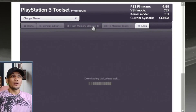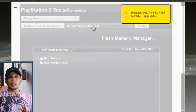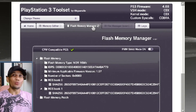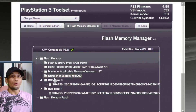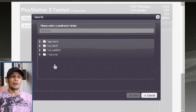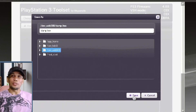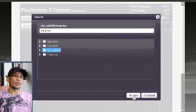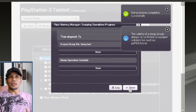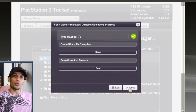If you receive any error message it is highly advisable to just reboot your PS3 to avoid any chances of bricking. Once it initializes and you did not receive any red messages, you can proceed. Go to the Flash Memory Manager. First, back up your flash memory — this is very important because if something happens and you brick your PS3, you will need this original dump to restore it. Click Flash Memory, then Save Flash Memory Backup. Choose dev_usb000 to save the dump file to your USB thumb drive, then click Save. Once you get a green check and the validity check is complete, check the health of your dump to confirm it's good to install CFW.